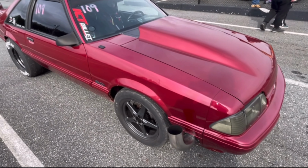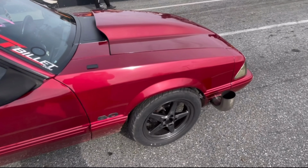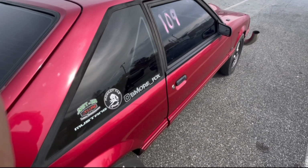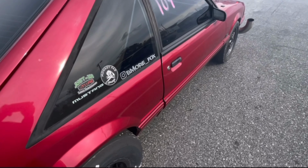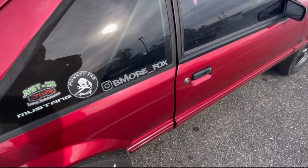Alright, so pass number 2 is done. Like I said, I set the cut to around 20 to revert back to wastegate so it wasn't such a hard cut at the end. But after looking at the log, it made way over 20. I think it was close to 25, and that's maxing out the little MAP sensor I have, so it could have been 30, who knows. So I'm wondering why it didn't revert back to wastegate.